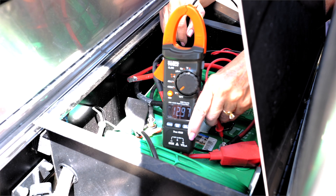Your coach battery needs to maintain a specific charge level to properly operate the 12-volt systems in the RV. If none of the 12-volt systems are powering on — like those overhead lights — then you might have a problem with battery charge levels. Some RVs have a monitor panel inside the rig that indicates the level of charge or even a specific voltage reading from the coach battery. A great investment for RV owners is a multimeter, which you can use to test voltage at both the batteries and any outlet to protect you, the RV electrical system, and appliances.